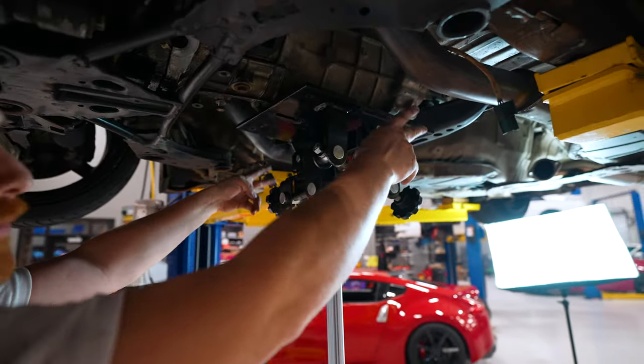You are missing a pressure plate bolt. Looking at the head, it doesn't look like there's a lot of wear on there, and we didn't find it when we took the transmission out, so I'm pretty sure that is from installation. Regardless, we're gonna go zip the rest of these off, and that one is stuck in the flywheel. We're replacing it anyway, so it can stay there.